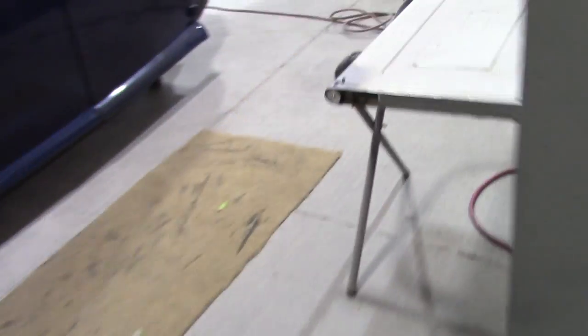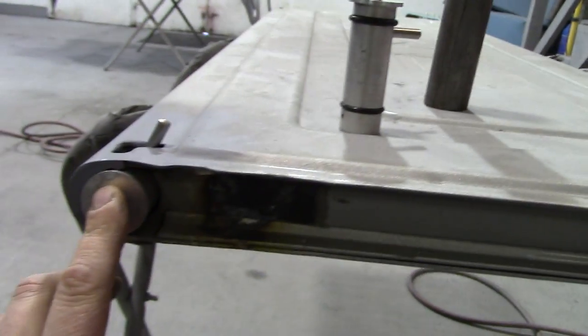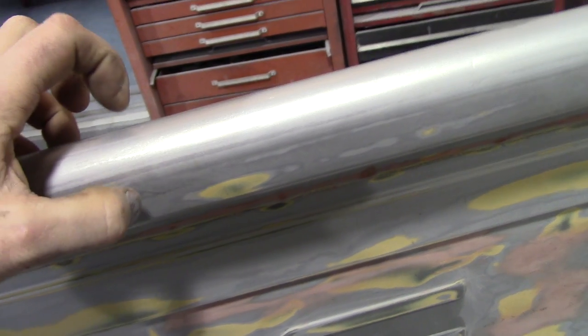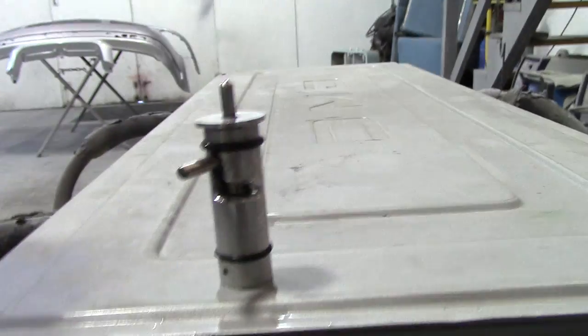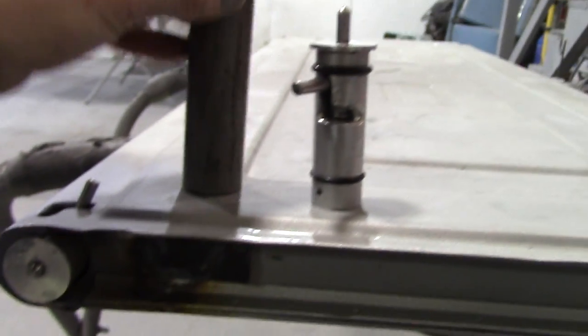Let's take a look at the tailgate up top. See, it's round right here, then it goes flat and angles in down here - it's not a round tube like the early Fords and early Dodges. So obviously these barrel locks are not going to work as-is; they're going to flop around at the end of the tailgate. The simple solution is just go buy yourself a piece of pipe, cut it to the length of your barrel lock, and measure that out.